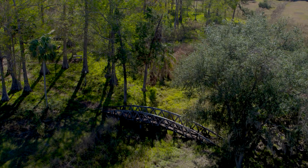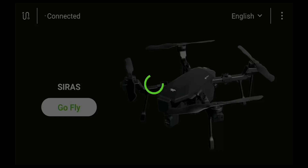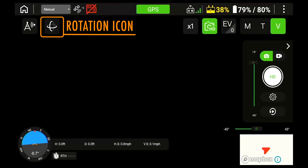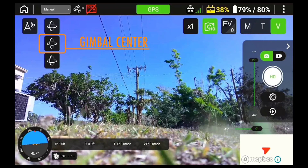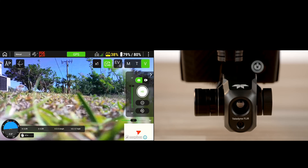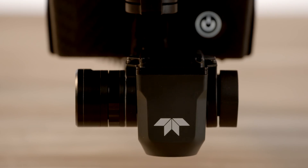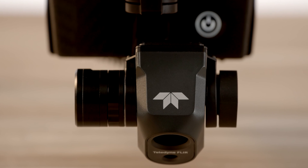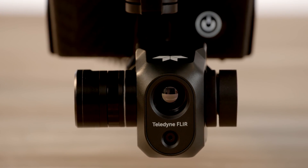The Cyrus has an on-screen function that allows you to quickly recenter the gimbal back to the center point by simply pressing the rotation icon next to the radar button on the main screen. You'll see two options: the first returns the gimbal back to its level point, and the second option points the gimbal 90 degrees straight down. This is a quick and easy way to get your gimbal back to its starting point without rotating the adjustment wheel on the remote.